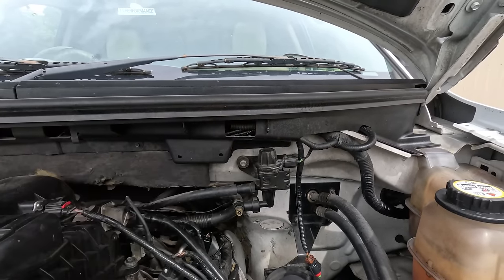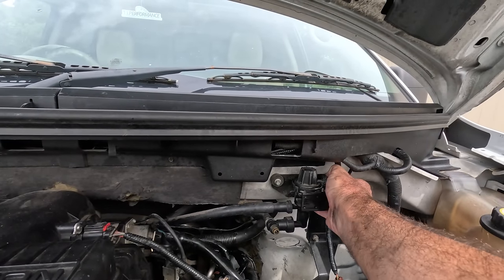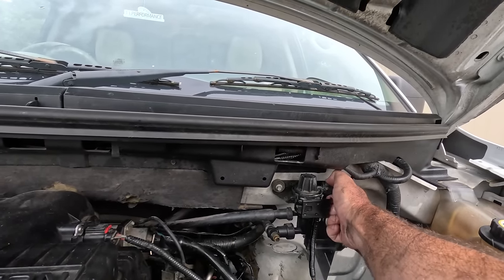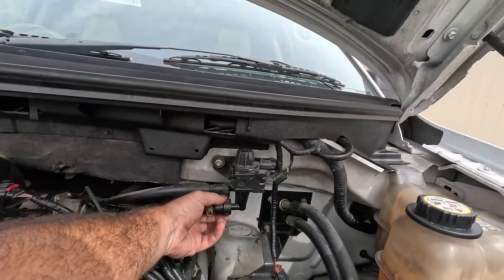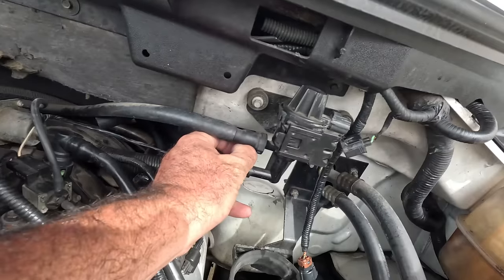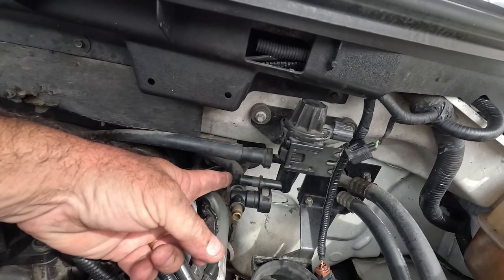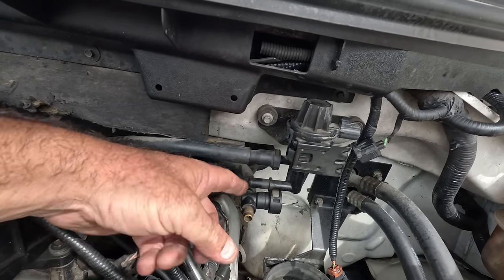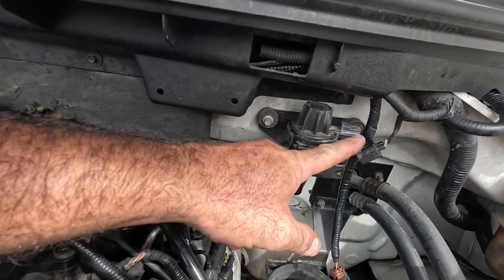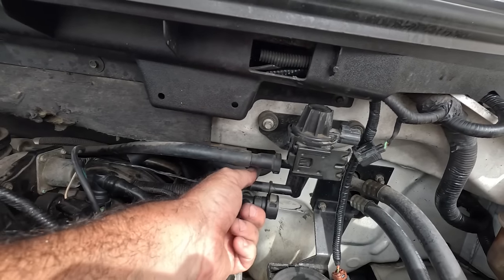And that's the control. To test if this guy is sticking open, unplug your power and then unplug the bottom hose like that, and then run the engine and just put your finger over the end. If you can feel any sort of vacuum when it's not getting told to open, then that's leaking. Now, that's not the case in this one,